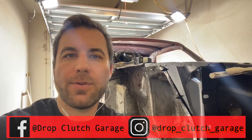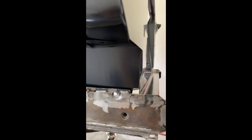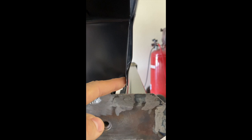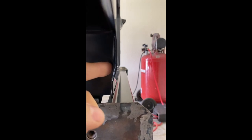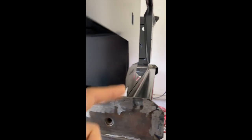We're looking at the right front fender apron. As you can see, the core support has this radius built into it that travels all the way across the front right side, and our front apron does not have that to match - it is straight. So I'm gonna have to probably cut here and here and try to massage the front apron to match the core support. I think that's a better option than trying to pound this out flat. Besides that, the front right apron fits very well.